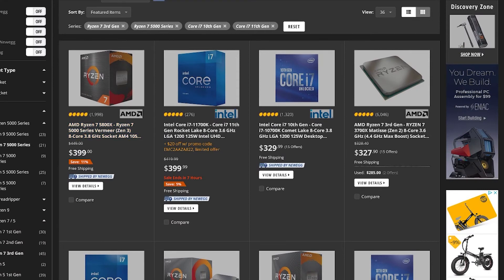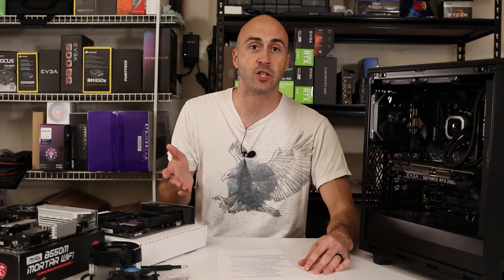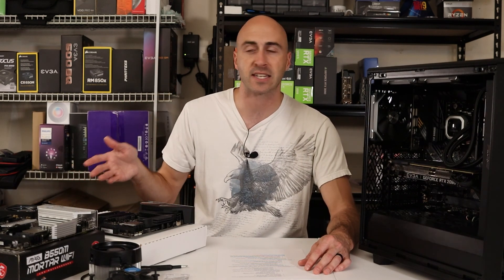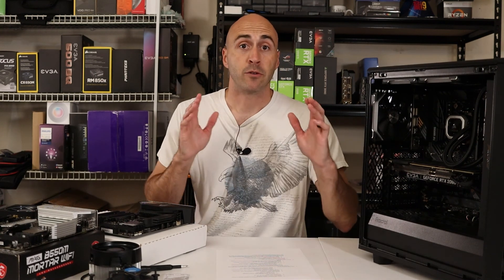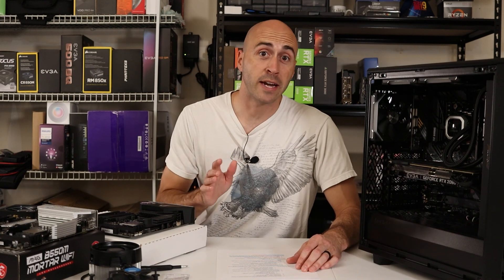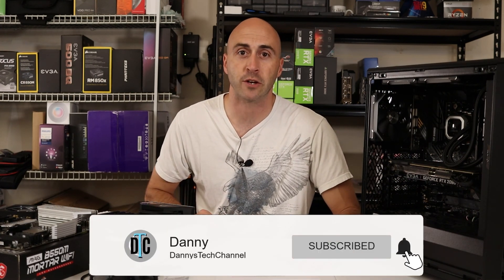When you're thinking about upgrading your CPU, make sure you need the increase. If you've got a newer generation CPU like a Ryzen 5 5600X and you're thinking about upgrading to a Ryzen 7 or Ryzen 9, you might not see increased performance in gaming or everyday use because those cores are not really utilized yet on a wide scale. But if you're doing workstation performance — video editing or something really intense — then you might see the increase. My recommendation: get an 8-core 16-thread CPU for everyone if it's in your budget. Something like an i7-10700K or i7-11700K on Intel, or a Ryzen 7 5800X or Ryzen 7 3700X on AMD — they will be great CPUs for years to come. A high core count chip is going to give you room for future gaming performance increases plus all that multi-core usage for everyday tasks. Both AMD and Intel have new CPUs right around the corner, so make sure you subscribe and turn on the bell so you'll get notified. I'm Danny with Danny's Tech Channel and I'll see you in the next video.